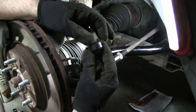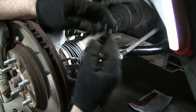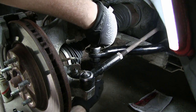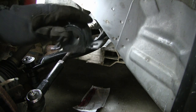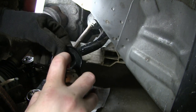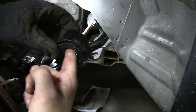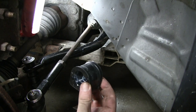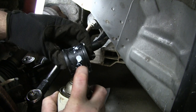Now with the bushings — there's a cupped edge and one little raised part. The raised part goes obviously towards the bottom. The new bushing has a little bump on the bottom which mates in down on the subframe — you want to make sure you get that seated properly. I'm just going to take a little white lithium, just a tiny bit, and give it a little on the inside to make things go easier when I slip it together. I'll also give the outside just a touch so that the bracket slips down on it real easy.